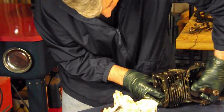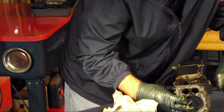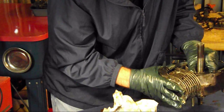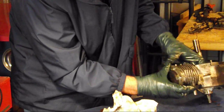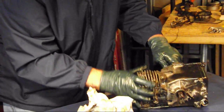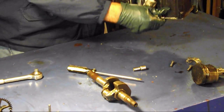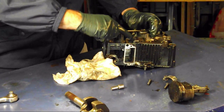I'm going to push my piston and connecting rod right on out — just like so. Now, my crankshaft should come right out like that. And the only thing left in this whole engine is this upper seal, and I'm going to pop it out right now just by leveraging it out.